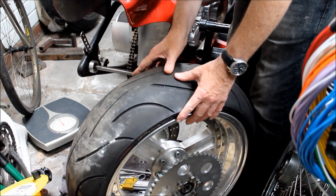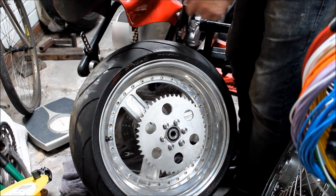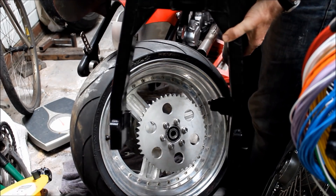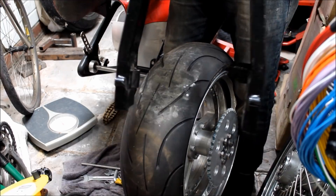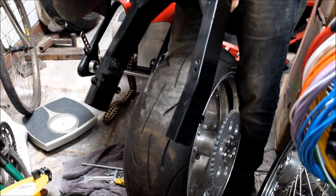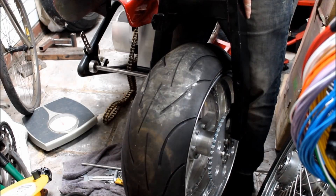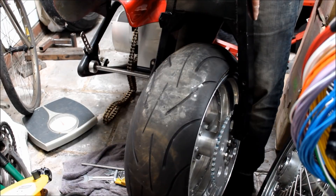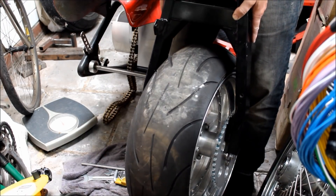Here's the back wheel taken from the bike, and I think it might be quite a lot wider than what was fitted to an original ZXR 750. That's a problem because this swingarm, which we modified, is from that bike, and if the wheel's too wide it obviously won't fit. There's a big tab here that needs to be removed. Let me just do a quick check to see if this thing's going to fit — we're going to have the alloy axle adjustment mounted on here yet, so let me just spin that round. Looks like it'll go something like that — I think we should be okay, just about. There's a little bit of room, but I also need space for the brake mount, so I'm pretty close.